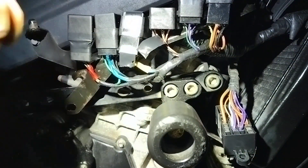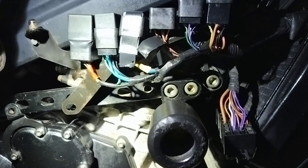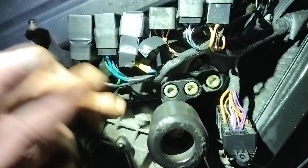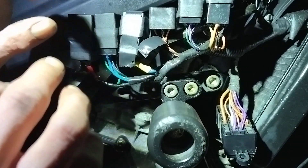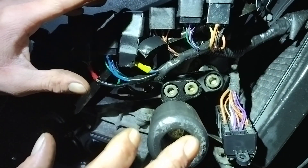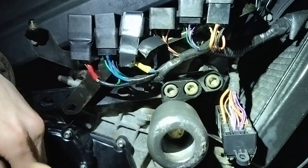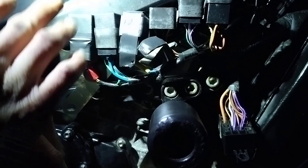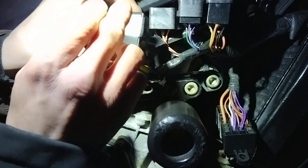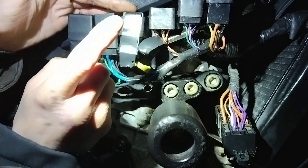The other idea I have in mind — same with these Triumphs — is that Triumphs have a safety circuit in the starter system. If it detects a voltage from the battery that's too low, this circuit kicks in and stops you from starting the bike. Essentially the bike will turn over three times and then stop, whereas most bikes will just keep turning or click. This safety circuit is on pretty much all Triumphs as far as I know, and to bypass it is quite easy as well. You need to first identify the starter motor relay — the starter circuit relay — which is this one here.